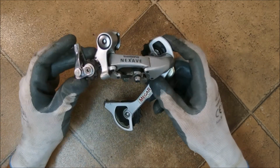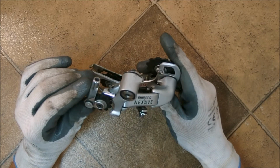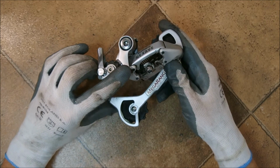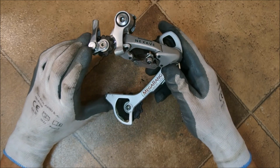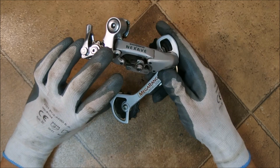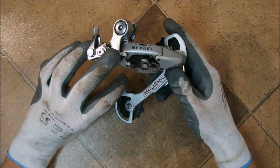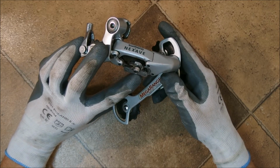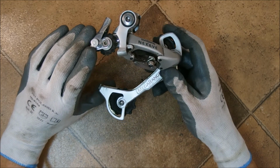In spite of these advantages, which are very important when you're riding a mountain bike, low normal derailleurs are pretty much extinct. And the reason for this is very simple. How they operated was simply put against what people were used to. Which means that if you had 7 bikes and 2 of them had a low normal rear derailleur, when you would switch bikes from one direction of how the gears work to the other, you would be met with an incredible amount of frustration, because the bike simply would work against your instinctual shifting, and that was infuriating.